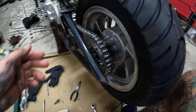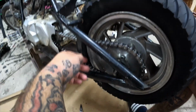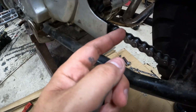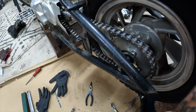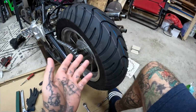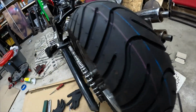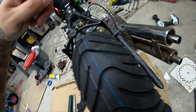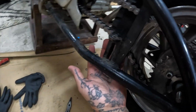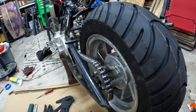And then the chain was, like I said, too short, just by like 2 millimeters. So I added a half link somewhere because I just moved the wheel. But anyways, yeah, so she's on, she's spinning. The last thing to do would be to bolt it up, put the washers, install the brake, and I'm gonna put a chain tensioner here, just like some kind of wheel, and yeah, should be good to go.